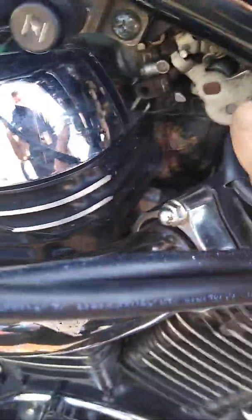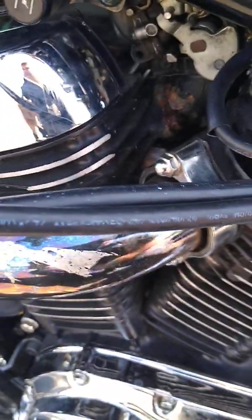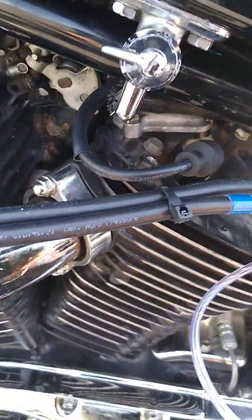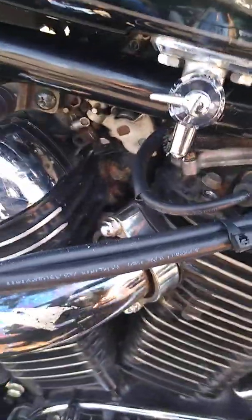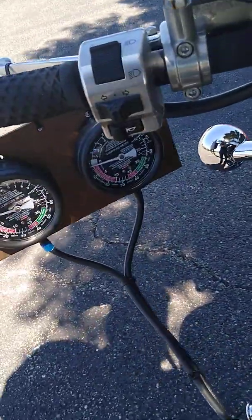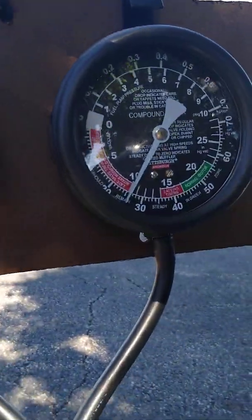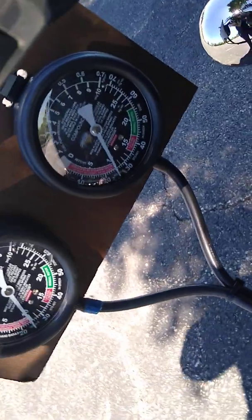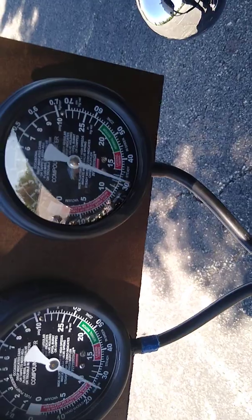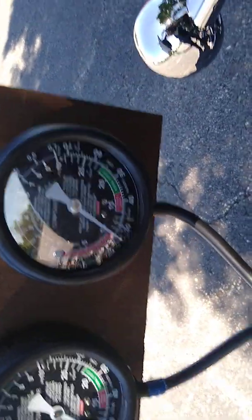What you're going to do is rev it up and notice that one cylinder goes wild — one just drops off and the other picks up, or it's stumbling all over the place. You want to set the rear cylinder to follow the handlebar, so every time you pull the throttle the rear cylinder does its thing, then you match the front cylinder to the rear. Once you match the front to the rear, it should gradually increase together. So here at idle we're drawing about 25 on each cylinder, and as we increase the gas — see how it dropped off like that.